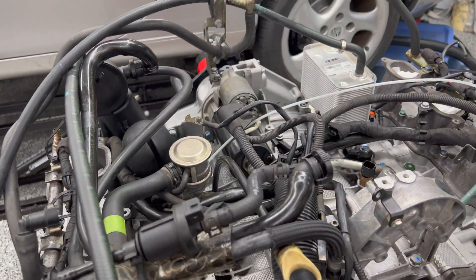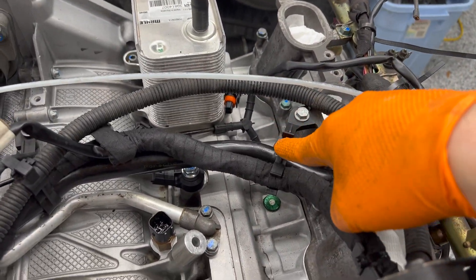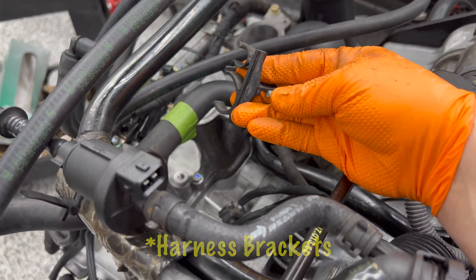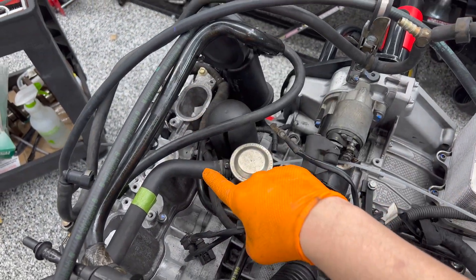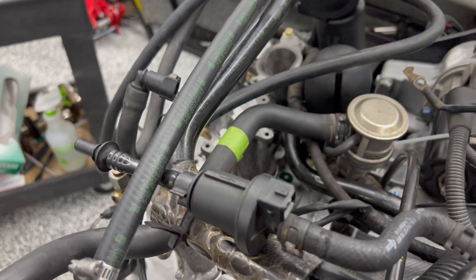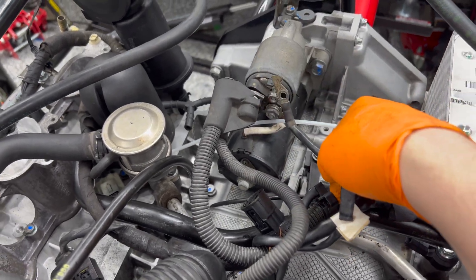I had to pause for a second because I needed to do a shout out to Finn from A Man in a Garage again. Special thanks for his videos because it let me know that there's not one or two harnesses but three. So I found it and I'm going to attach it. This conduit here reaffirms that my routing is correct — the wires go around here and route through this clip and around the AOS to the other side in an S-shape. Making progress and I've got the grounding cable in place.